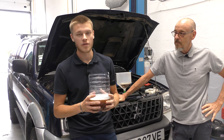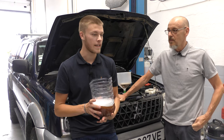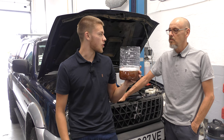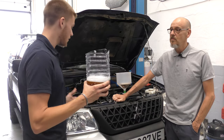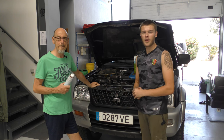What we'll do is fill it up with water again, flush it through up to temperature, empty it, and do that twice. Then the third time we'll leave it with fresh coolant in. So we'll do two more flushes. I'll also do a short follow-up video probably after a month to keep you updated on what it looks like.